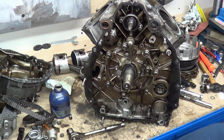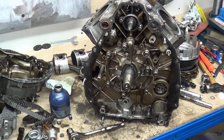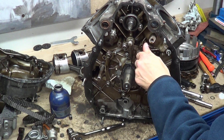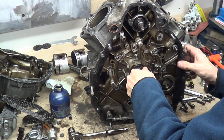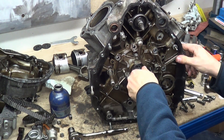Today is the day of dropping things. It's getting pretty crowded — there are another two projects I'm doing at the moment. Like an idiot, I never do one thing at a time. There's a weight missing — if it's not in the box with the parts it came with, we'll machine a new one. We've removed all our bolts and now we've got crank end play, but that's because the gears with the thrust surface have been removed.